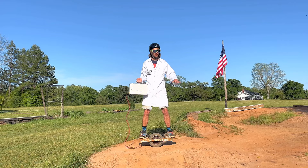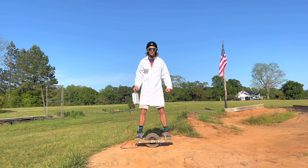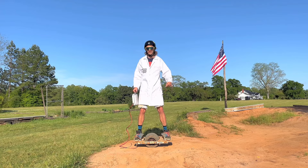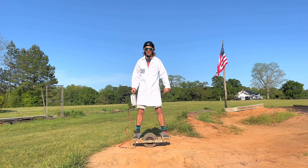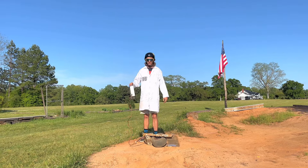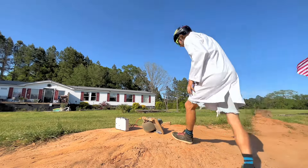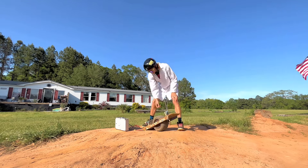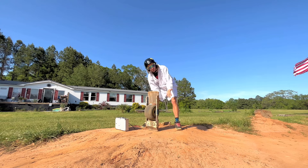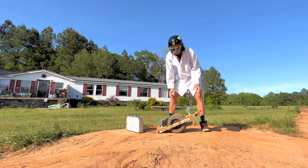Taking that into consideration, it was set off the correct way. What if you had a battery in a backpack and you didn't have to hold anything? The board really does feel — it feels like a skateboard right now. It doesn't feel like a 28-pound one wheel. It feels like I got a skateboard under my feet and it feels really good. It's so lightweight — I have to say, success. It's so lightweight without a battery because now the only real weight is going to be the motor, which is like 7-8 pounds. I need to weigh how much it is without the battery in it, but it feels great.